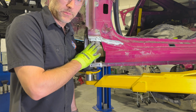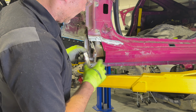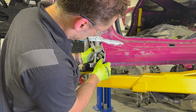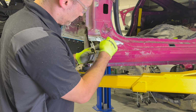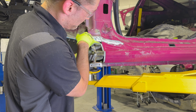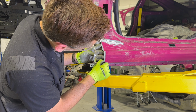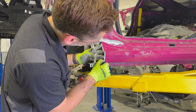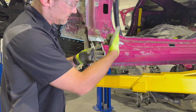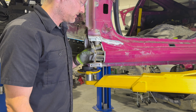So I cut apart the other panel, and I made a little patch pad. So this guy is gonna go behind here. Fits in nice. Now I left some space because there's a seam here where the two panels overlap, and there's some panel bond behind it, so I don't want to interfere there. So I'm going to glue this in place with panel bond, clamp it, and let it sit, and then I'll stick the other panel over top, and we're going to use this as a back to weld down and get everything nice and square.